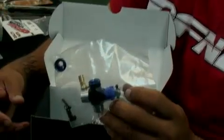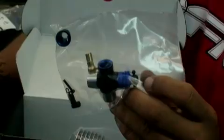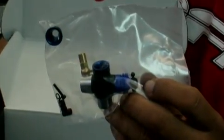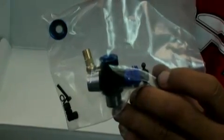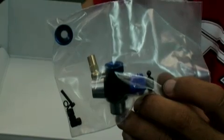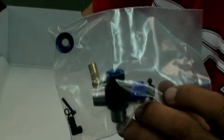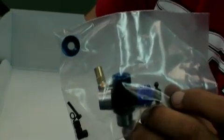This pipe combo with this engine is going to make a really good performance package. You don't have to run around and buy another pipe — you get this with the engine, you'll get a killer deal. Looking at the carburetor, it has been revised. There are revisions you might not see through the carburetor itself, and that's going to be the needle. The needle has been revised with a smaller borehole in it, so you get more run time or fuel time into the system without adding the extra amount of torque. You get a smooth, crisp feel and acceleration, but yet you get the run time to go with it.